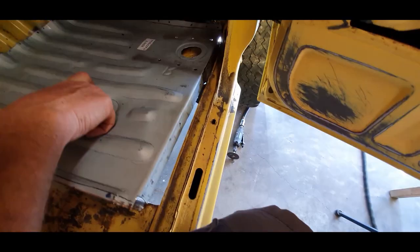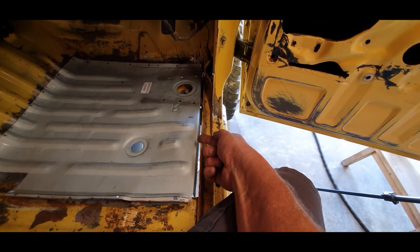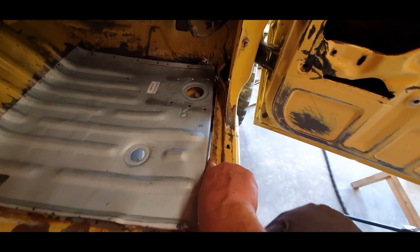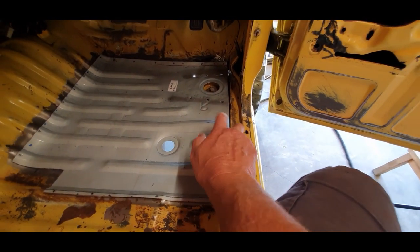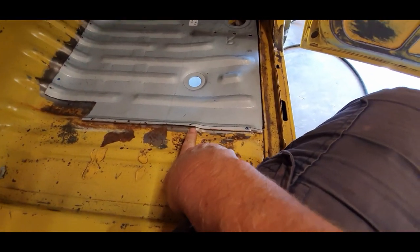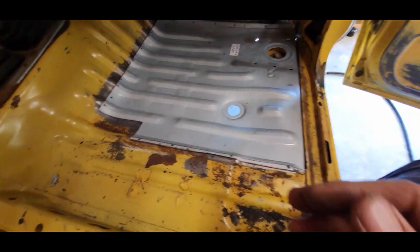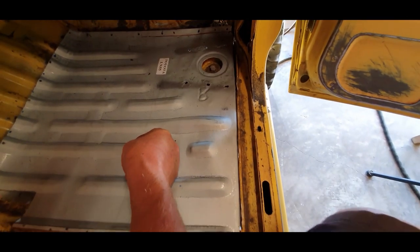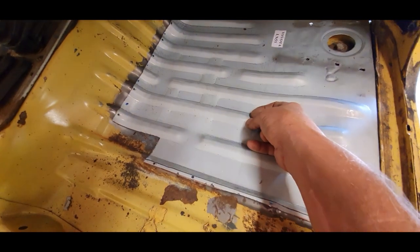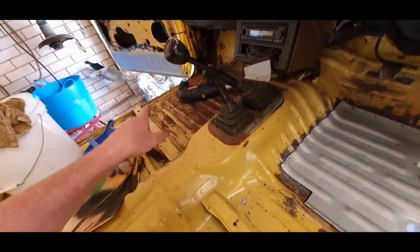There's going to be a little bit of an issue with this floor pan. This piece on the side right here is still in the truck from the original floor - this is how it would have been made. I don't want to cut that piece off because I'd have to butt weld and there's filler and sealant on top. I wanted to use that flange and weld through it onto the original body, but the problem is it's pushing everything over a couple of mil - three, four, five mil - so it's not sitting properly on these ridges. I'm going to have to wedge this up and weld it underneath first, tack it, then with force bend it down. I'm about to wire wheel.